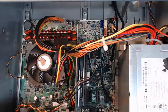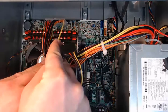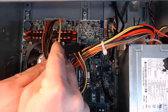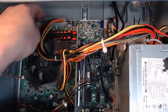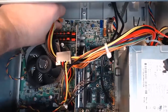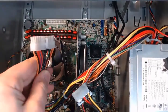Let's continue and we're going to remove the power supply. In order to do this, we need to disconnect it from the motherboard. Up here at the top, you can see I have a 24-pin main power supply connected to my motherboard — it's got that little lever right there. We're going to pull that back and pull this thing straight up off the motherboard. I'll put my finger on that little lever and grab it and pull straight up. Got it — there you go, with the lever and all. You can see that clip on there.